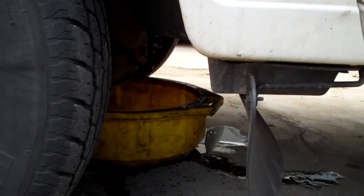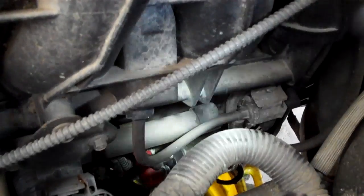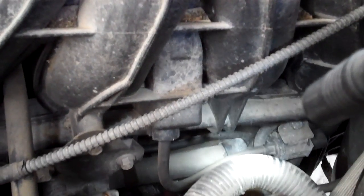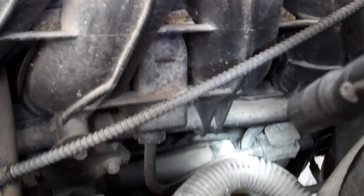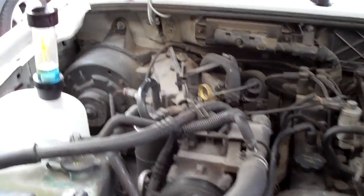This one's leaking pretty bad, as you can see under there. The leak is coming from — you can see it's dripping onto the starter. You've got this hose right here, and then further back it splits into two different hoses. There's this obnoxious black plastic splitter that just falls apart, going from the fat hose to the other — one to bypass and one that goes up behind the motor. Anyway, it overheated, and the dealership diagnosed it as a failed head gasket.